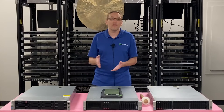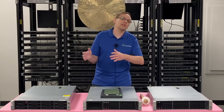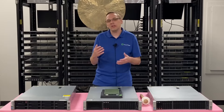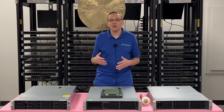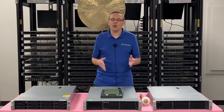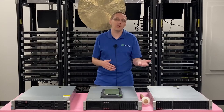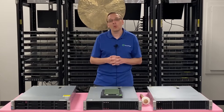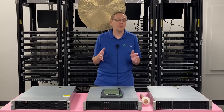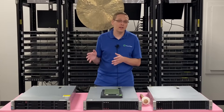On top of that, if you're filling up all of your memory channels completely — every DIMM slot filled — it clocks down a little bit more. So there's some ambiguousness in saying what the max speed is for your ProLiant. If you have any questions, message our sales team and we can help you figure it out. Right now I'm a big fan of the 32 gig 2400 ECC reg and the 64 gig 2400 LR DIMMs as sweet spots for price.